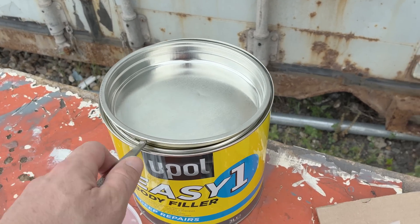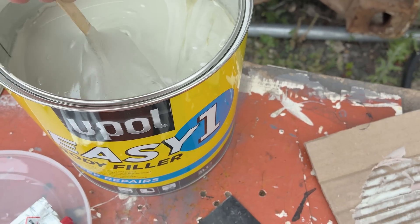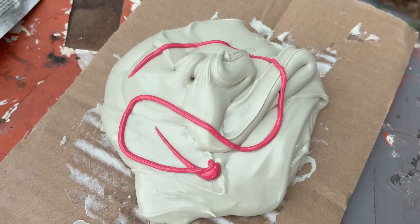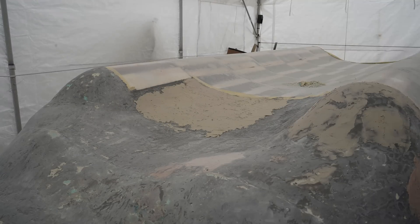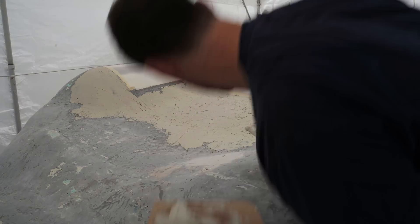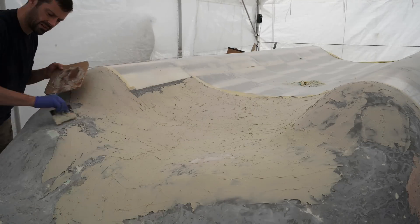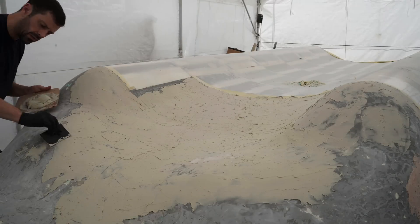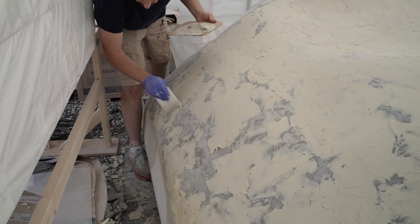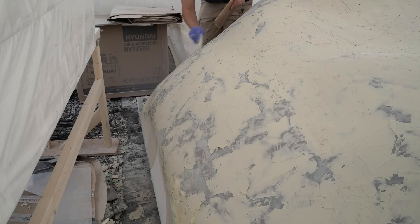This was unsurprisingly a much quicker setup as some kind soul had pre-mixed this in a large factory. The shops didn't have much stock and I needed to visit three to get just two tubs. You simply need to activate the polyester resin hiding in the filler with catalyst — not MEKP this time but BPO paste. Stir lots and quickly over to the tent as the 20-minute working time is very optimistic in this heat. I'm trying to spread carefully to offer a smooth surface, only filling the indents and low areas, minimising sanding later. It's amazing how a part can transform once all one uniform shade — it's also a lot easier to spot problem areas where the surface or shape is wrong.